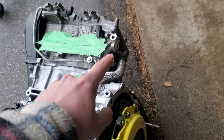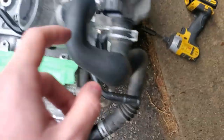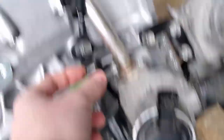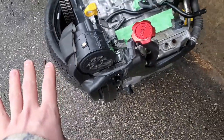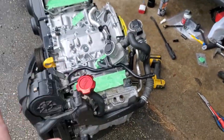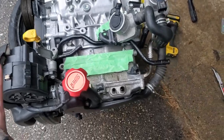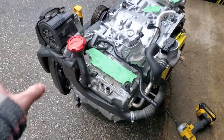There are just a couple of 12mm bolts holding that on, this runs down a couple more 12mm bolts, another 12mm — just a bunch of 12s and 10s. I didn't even install everything; this is still loose. I just threw it on quickly so you guys could see. So I'm just going to remove all this in the process that you guys would see if it's in your car, just so you get an idea of what to remove. Basically, all of this is going to be removed to clean up space and replaced with those block-off plates.